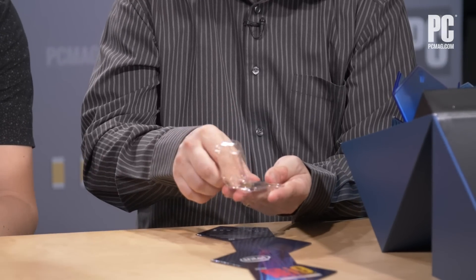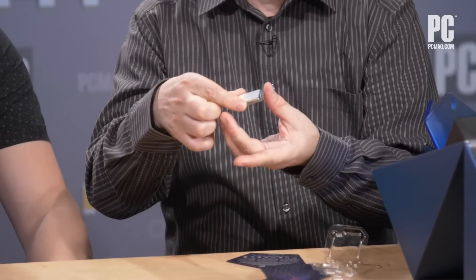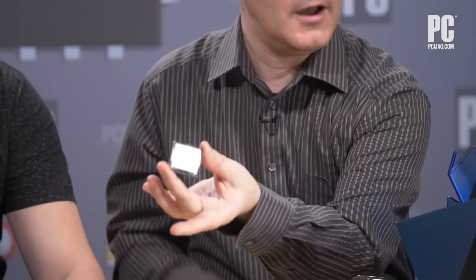This will work in the same motherboards that a 9900K would, which would be the Z390 chipset, which will enable the overclocking. You will also want a robust liquid cooling solution. You'll notice in this giant box of stuff, there is no cooler. Most chips come with at least a stock air cooler in the box. Intel's Core i9s don't — they expect you to bring your own to the party.